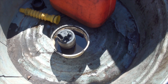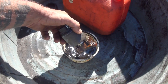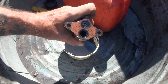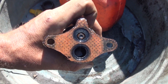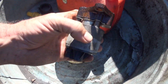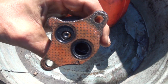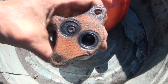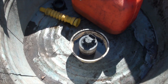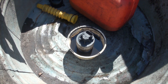Now I've shown you how to check your EGR, I'm going to show you that you can clean your EGR. The one that was originally on this engine may have been worth cleaning and trying, but I have a lot more faith in this one because I could tell by the lack of rust it's fairly new. I have a little container of gas — I'm going to set this in there, let all the carbon soak, then blow it out. About 20 minutes in it's good and wet, and probably all of that carbon and soot will blow right out.